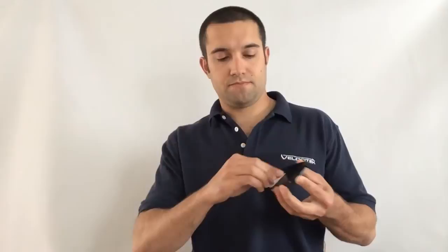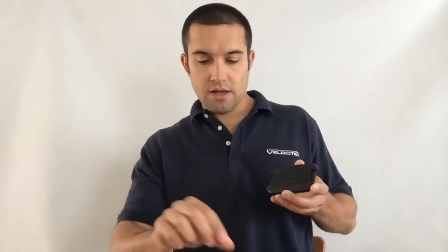Once you get the kit, here's how to install the pieces. First, clean the battery compartment lid with the alcohol wipe and let it dry. Once the battery compartment lid is dry, stick the PVC strips to the top and bottom of the ProStart battery compartment lid. Use the ProStart logo on the lid as your guide for placement, and get them as close to the corners as you can, but keep them on the flat surface.